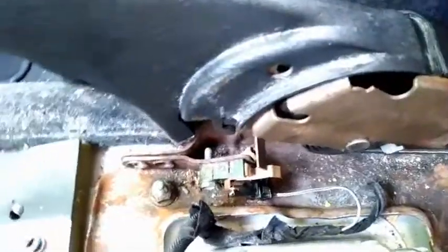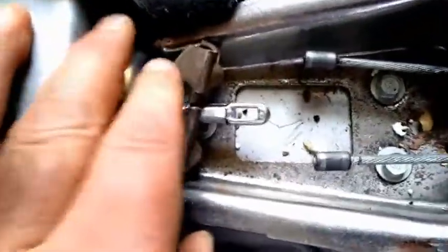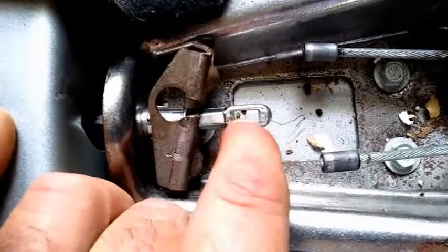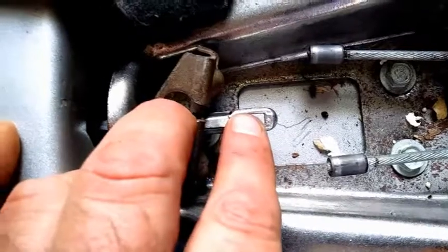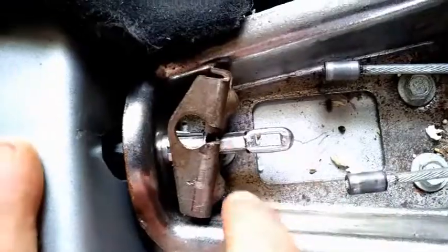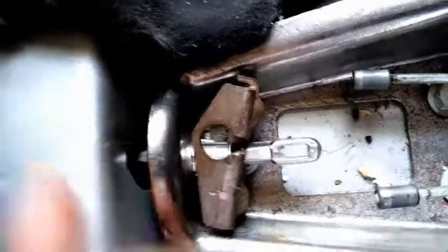like I had shown earlier. Okay, you can see I got my cable in, and most importantly, don't forget to connect that wire if you took it off. And then we're going to connect the rear now. Alright, I've got my bracket in place, and then you use a screwdriver or a wrench or something and pull on this. This cable's spring loaded now because it's loaded through your lever, and then slide on each one of the rear cables through the sides, and that's it.